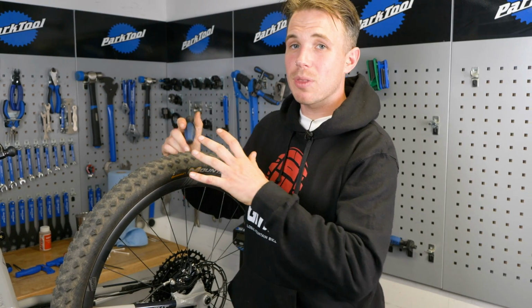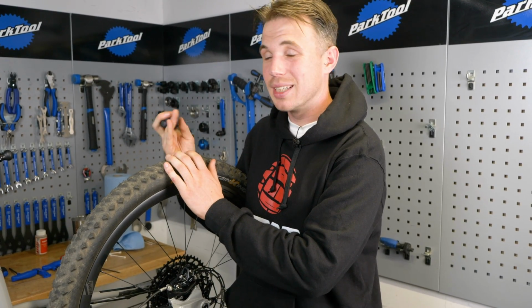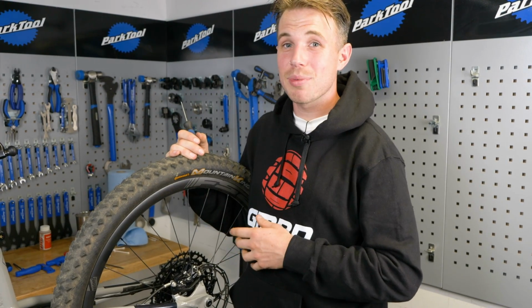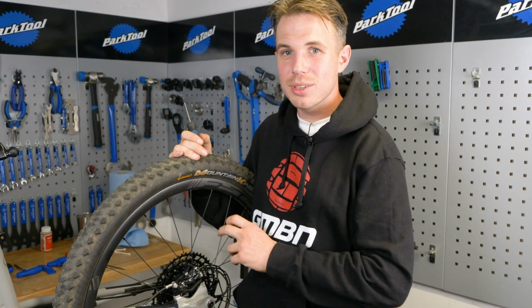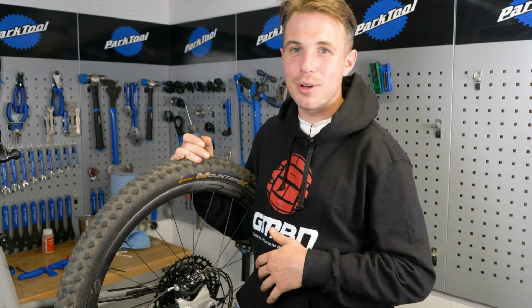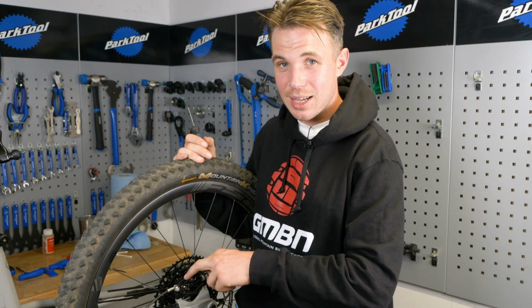It's a bit like, you can have the best suspension and the best geometry in the world, but if your tyres aren't gripping because the pressure's wrong and you've got 60 psi, it doesn't matter. It doesn't matter how good your bike is. Similar with your brakes. If your pads and your rotor are absolutely cooked, you can have the best bleed, the fancy pants 4 pots with ultimate power. It's not going to make any difference. That's the contact point. That's the most important point.